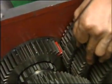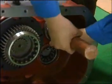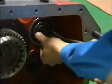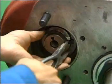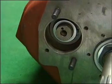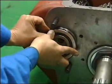Time the right countershaft with the gears of the input shaft. Install bearing 102308E at the rear end of the right countershaft and use a copper stick to knock it to right position showing up the stop groove. Install the stop ring to right position with snap ring pliers. Install the front end stop ring of the countershaft into the groove in the front. Install the washer of bearing 192309E at the front end, set the outer stop ring on the bearing, and use a copper stick to knock the front bearing of the right countershaft.